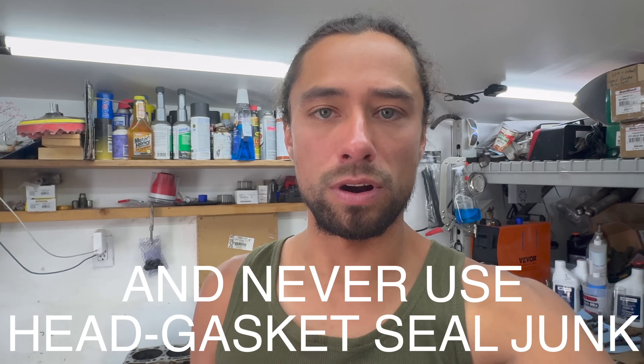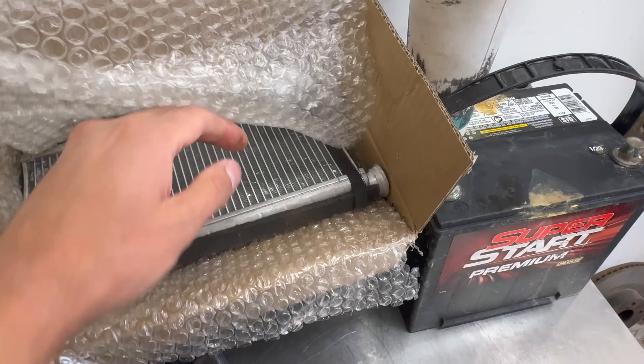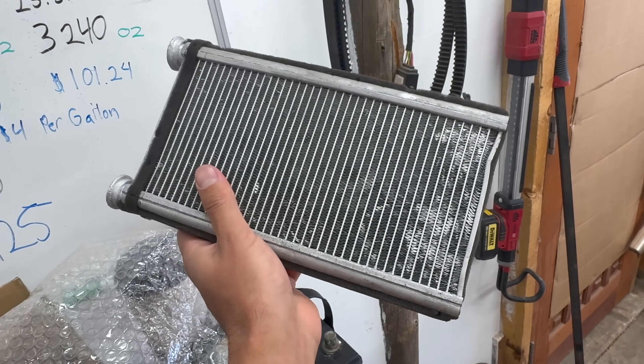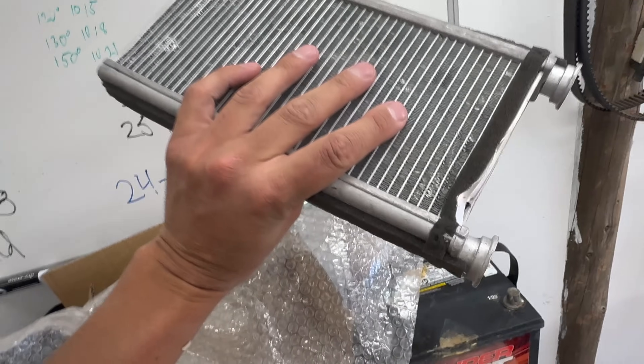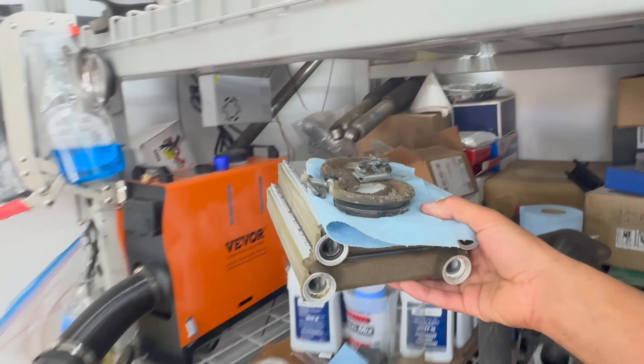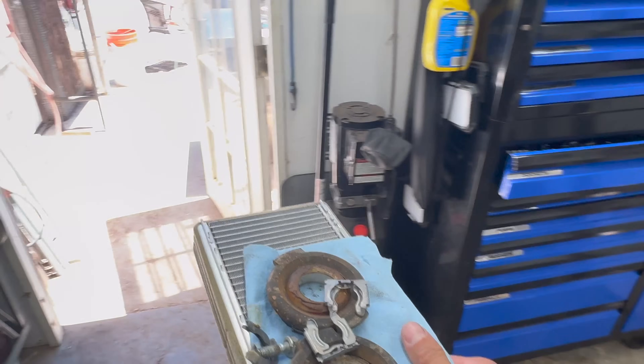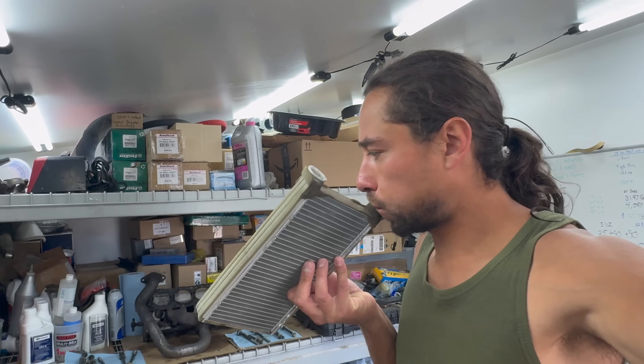So I want to urge you: if you have bad head gaskets, check your heater cores. I ordered one on eBay and they sent me a damaged unit — someone obviously tried to install it. They gave me all my money back, but it was super annoying waiting on that. So I went to the junkyard and pulled three heater cores. I got that Forester running good and now I have two more in stock. Just blow through a heater core to test it — the one I took out of the Forester you couldn't blow through. These new ones are nice and clear, so I'm happy putting those in.